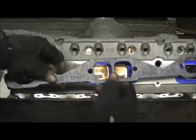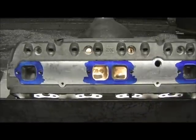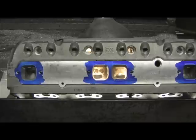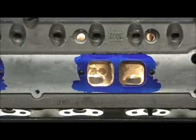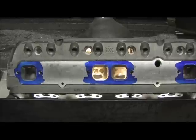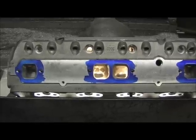I just wanted to show you what print I went with, and 100 thousandths on the roof is a good shot. This dimension will work with a 1-5/8" tube header as well as a 1-3/4" — it'll go both ways. Nice looking exhaust port. The heads really do have a lot of good qualities. Let's go ahead and finish the exhaust port up. I've got some bobtailing to do — I'll show you that, and then we're done.